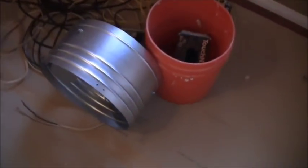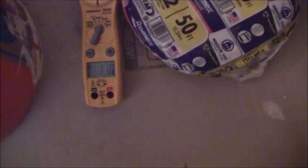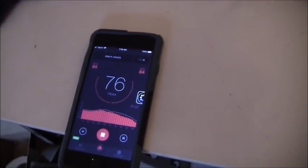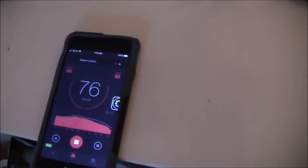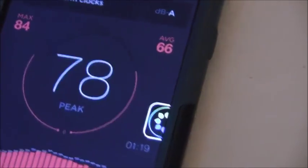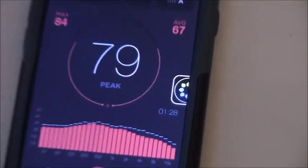Alright, I'm all set to do my test. I've got the fan wired up with wire nuts, thermostat set down low. I've got an amp meter and a decibel meter. Let's go ahead and turn it on. There's our amp draw: 1.16 amps. And here's our decibel rating - it says it's the same as an alarm clock. 76 decibels. It's jumping up because I'm talking.